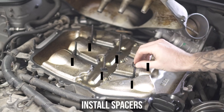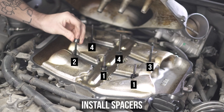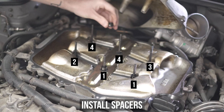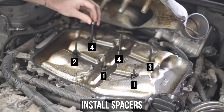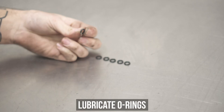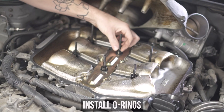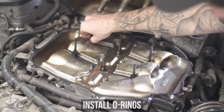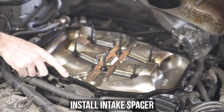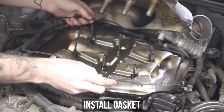Now's the time to grab those sweet-ass numbered inserts and match the numbers in your hand to the locations and numbers shown on the screen. Man, technology is great, isn't it? Numbers and stuff. This is a super critical step, so don't mess this up. Now grab some lube for the O-rings and pop one on top of each provided spacer. They don't need that much grease, so don't go nuts slabbing that on. Now take your aluminum onion ring and install it the only way it can go on, with the thick side facing towards the radiator and all holes lining up where they should be.